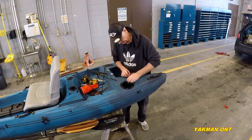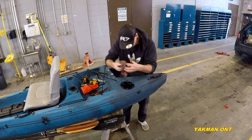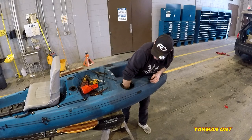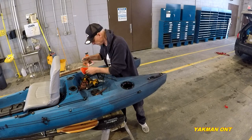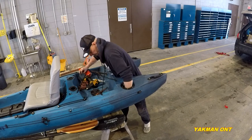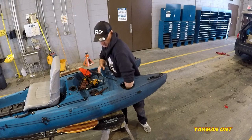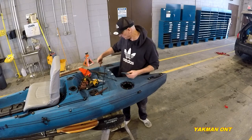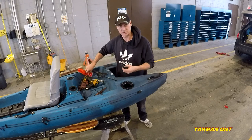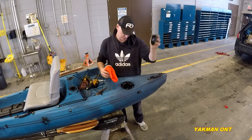After you've snugged them, tighten them all up, then come back and snug each one up tighter. Before that sealant dries, just wipe off what's pushed out the edges — that's why you don't use too much or you'll make a mess. Pull out what you can. Keep these cutouts: if you ever have a crack, you warm it up and you can melt it. It's great for plastic welding — a lot of guys can't plastic weld because they're not using matching plastics, since certain plastics won't stick to others.